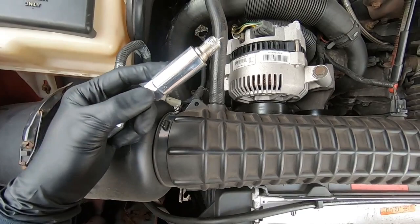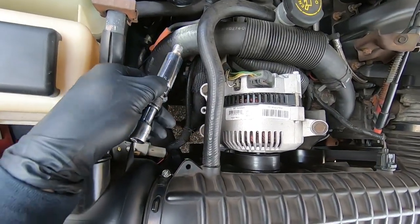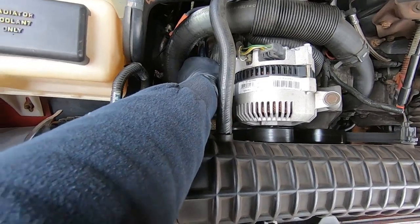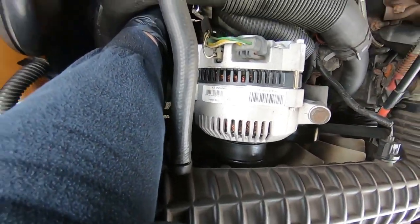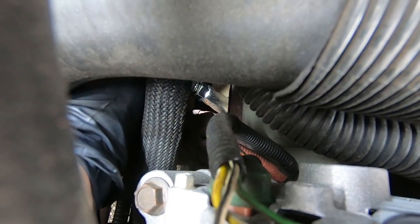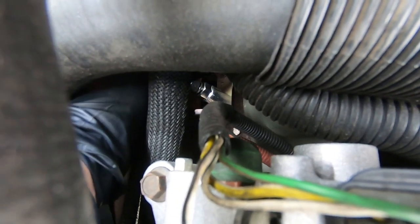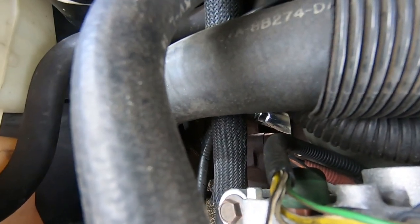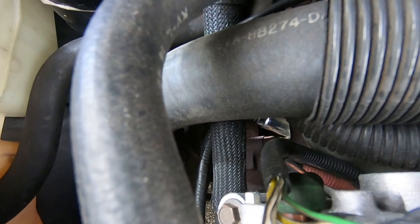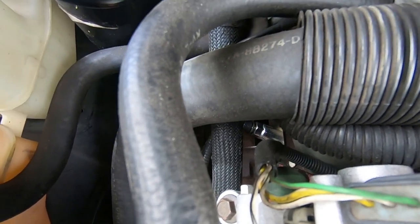I have the plug in our 5/8 socket with the extension and I'm going to guide this through the same way we came out and start finger threading it in. I'm just going to navigate my way to the hole. I am in — I'm going to finger thread this in until I can't finger thread it anymore, just hand turning it into the cylinder. It is now tight. The torque spec for these is 7 to 15 foot pounds — for this particular push rod motor it's 7 to 15 foot pounds. That's a pretty wide range; you can get away with just a snug of a socket wrench, like a half turn.